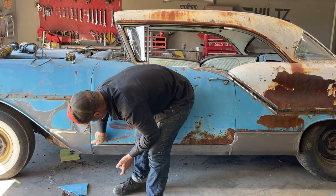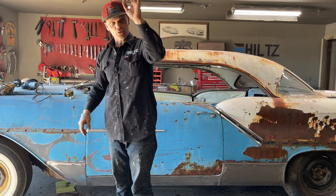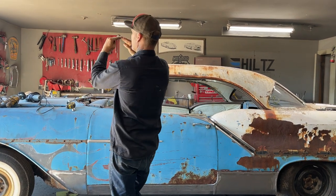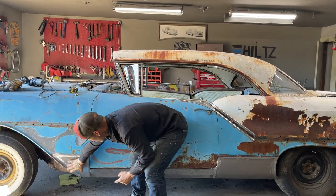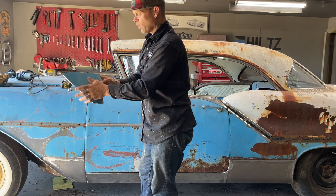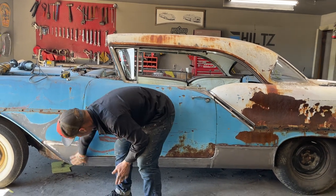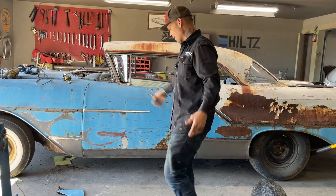I put a 90 on this, and the way I got this fender to go nice and round is I used the shrinker because I put it on that lip, and I shrunk the metal, and if I'm going to shrink the metal, that brings it together. If you're going to stretch it, it pulls it apart. So what I've done is I put a 90 on the pattern. I'll show you: a piece of cardboard, made a 90 on it with the brake, took it in there to the shrinker, made it round, or made it this shape until it fit, and then that's it in a nutshell.